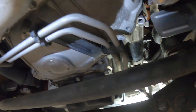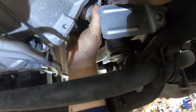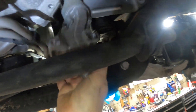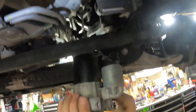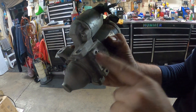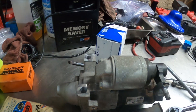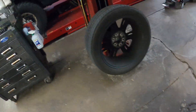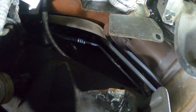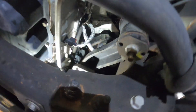I did have to take that heat shield bolt out because the heat shield doesn't come out otherwise. The starter is loose now — it's a small starter — and hey, look at that, we got it out! On some of the older models with the 6.0 liter and 5.3, you have to drop the sway bar down, but not here. You do have to take that heat shield out. It doesn't look like we bent the heat shield up any, so the heat shields will stay there.